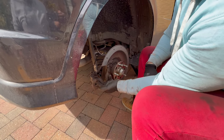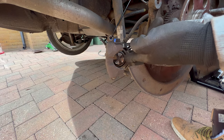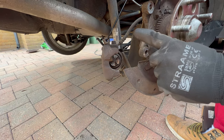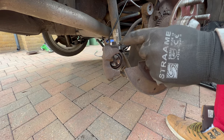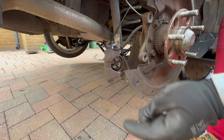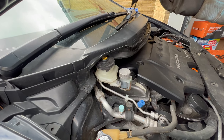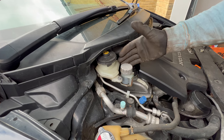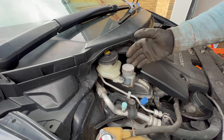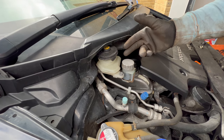After cleaning, you can twist back the brake piston. You will need a brake piston rewind tool in order to twist it back, because you cannot just push it — it has to be twisted. Before you do that, make sure you open the brake fluid reservoir cap to let the pressure release from the reservoir. Open the hood, find the brake fluid reservoir cap, and loosen or open it. That way you don't need to fight the pressure while twisting back the brake piston.